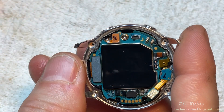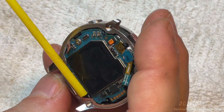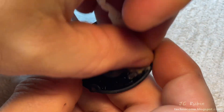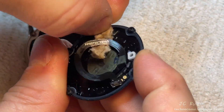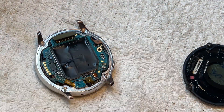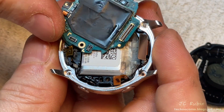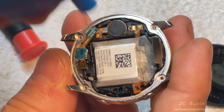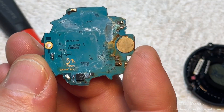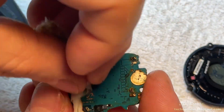The next connector came off without incident; DeoxIT applied under it on both sides. The largest connector came off again without incident, DeoxIT applied. Things are starting to look better. Coming back to the rear of the unit, cleaning up those connectors — they clean right up. I was also able to remove a lot of rust embedded in the plastic. A small Phillips holds the main board in place; the board is gently negotiated out from the overlapping cables, which are disconnected. The battery looks a bit bloated. I dry out that section with canned air — could be water back there or the DeoxIT already sprayed. The back of the board doesn't look wonderful, so I hit it with DeoxIT again and gently attempt to remove rust and debris with a paper towel.